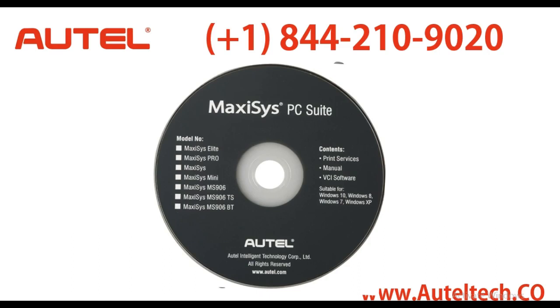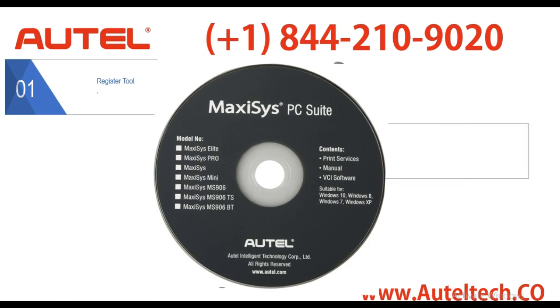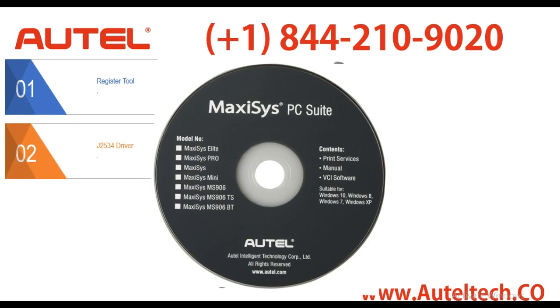What I found with the kits that come with the Elite, the Pro, and all the other tools is that Autel doesn't update the latest software onto the CD. Knowing this, what I actually do for my clients is install the software from Autel's server directly — that way I know it's the latest software. To take it a step further, I do all the registration, which normally takes people about 15 minutes on average but I can do it in 45 seconds. The second thing I'll do is download the J2534 drivers for programming, then install the VCI software update application, and lastly the printing application.